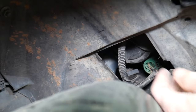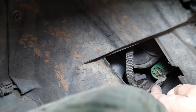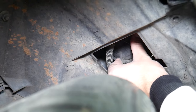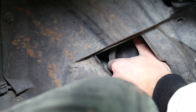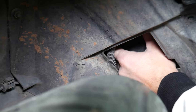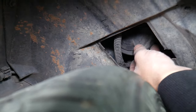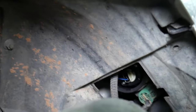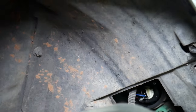This is just the connector — the green thing. Do not confuse it with the bulb. The connector you can disconnect, but there is a cover here that you turn. We're going to turn that counterclockwise about 30 to 40 degrees and it will come out. That's where the bulbs are located.